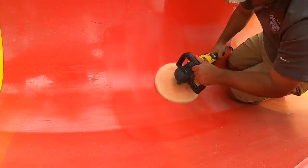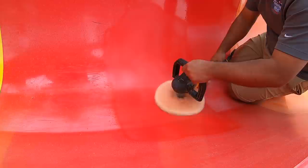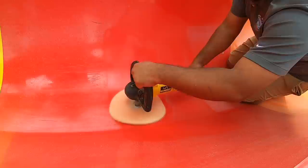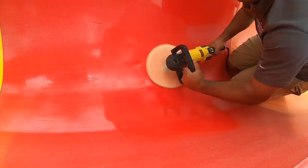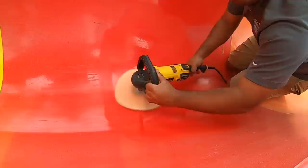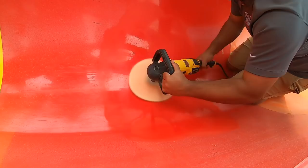This is a really uncomfortable position — especially on your hands and knees. Our team always has knee pads available, and masks too. You can see I'm not going too far — I want to point out my work area. I spread the compound, now I'm going to high speed. The shine is starting to come out already. Not a lot of pressure — just letting the buffer work. My left hand is just controlling direction and angle. The pad is super flexible and can bend in many ways, which really helps.